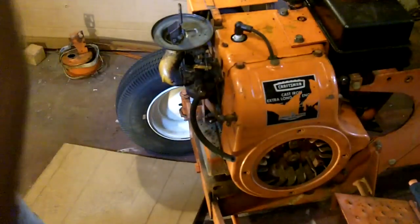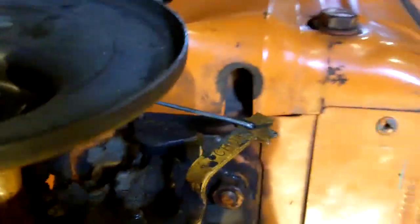You want to see too? Come on over. I'll show you what I just did. Now I'm sure you could probably see that from where you were, so I was talking about it. The cable is bent down and then bent over, so it has to go straight down in and then over to catch that little loop. And then over here, there's a tab that's in with the head bolt for the engine, and I needed this tab that goes over it that pinches the cable. What I was showing you was this cable is not long enough to go on top of the heat shield or in front of it. I have no choice. It has to go in with the muffler. So I think what I'll end up doing is probably drilling another hole in this and putting some mechanics wire just to keep that up against the shield and out of direct contact with the muffler.